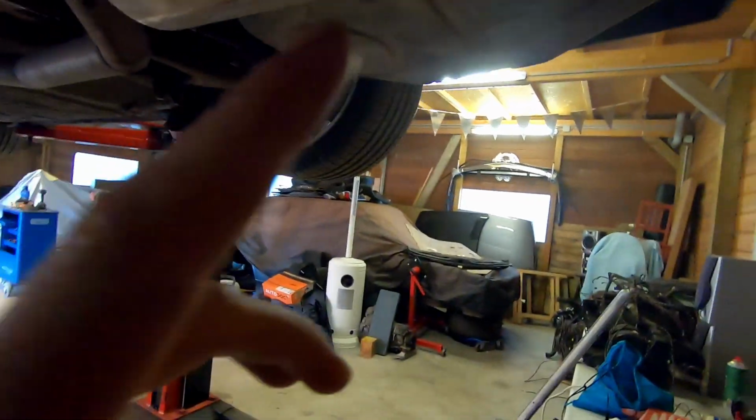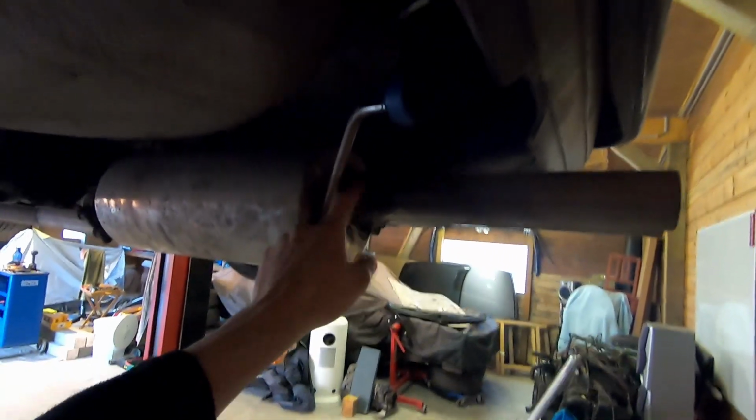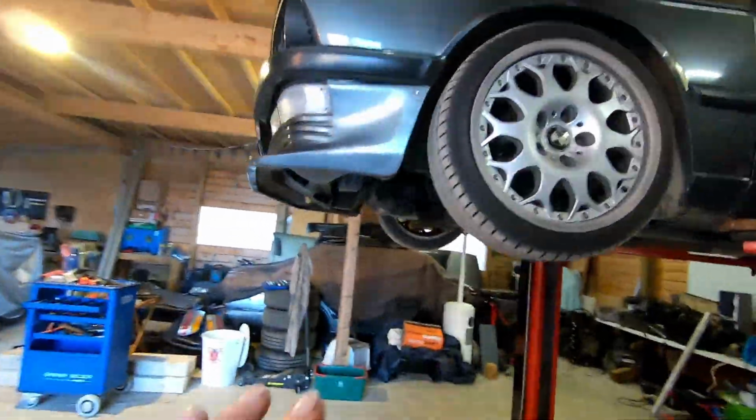Then I've got a 90 degree bend that I'm going to put at the end here to point the exhaust to the ground. Because my car is a few decibels too loud for the limit at Zolder. The limit is like 98 decibels. My car makes over 100, so I hope that will be enough to keep me from getting penalties. Because if you get two penalties, you have to quit.